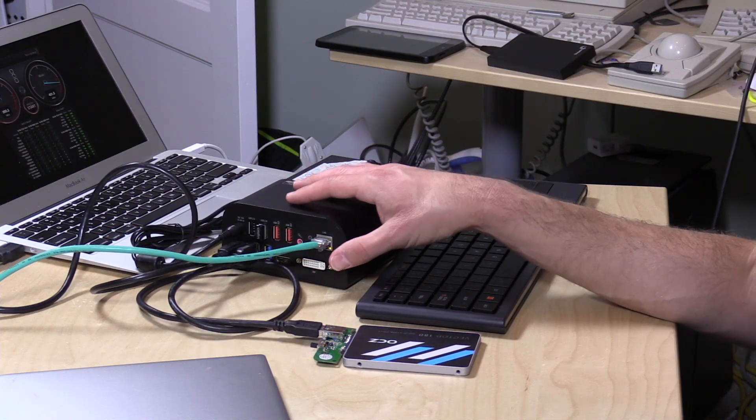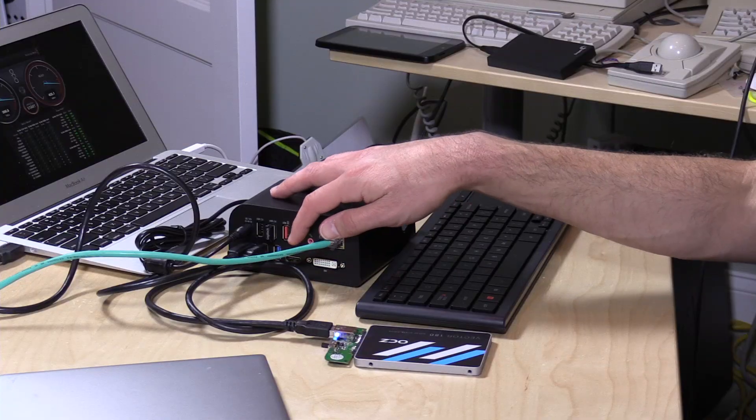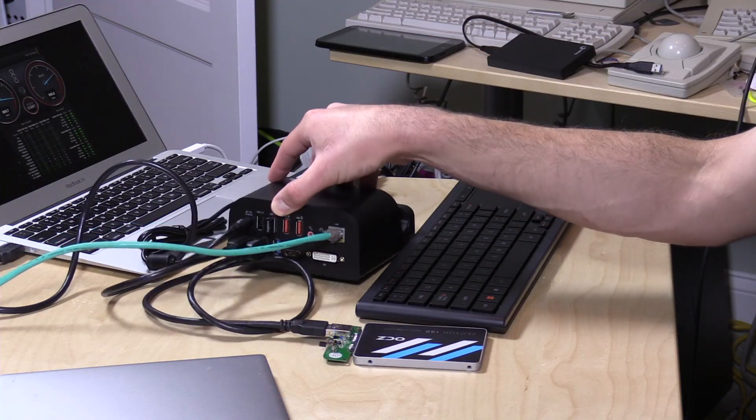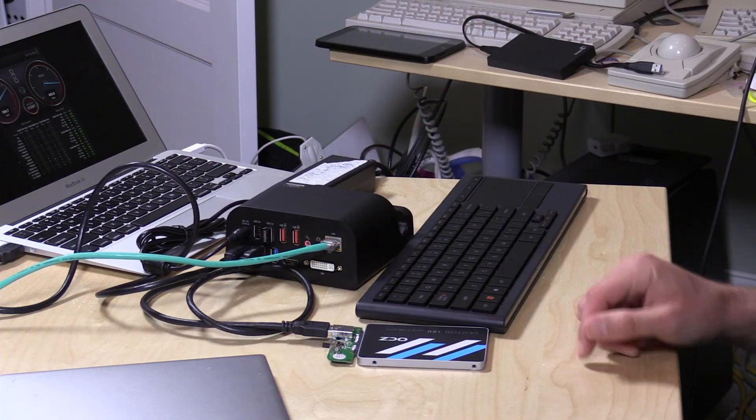If you have a faster computer like an i5 or i7, you'll do really well with this. I want to make clear this is not a gaming display port — you can play some games, but AAA titles are not going to work very well because it doesn't have a dedicated GPU. On the lower end you could play some games, but you may get latency and not a great gaming experience. These display ports are really designed for web browsing, email, and work. But overall it's a pretty nice dock, especially for a USB 3 dock to have all of this including display adapters in a single, compact unit. That is the Sabrent USB docking station — this is Lon Seidman, thanks for watching.